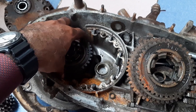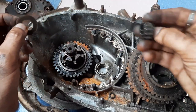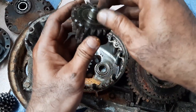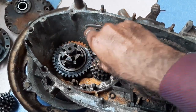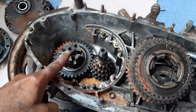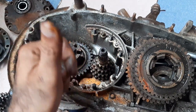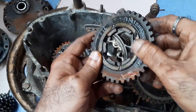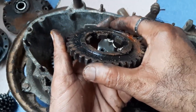I am now placing the fourth gear — it's in. After that, you place the needle bearing, and then replace the collar. The fourth gear's boss faces the sky; the remaining three gears face the earth. This is the third gear being placed — the boss faces downward. It is going in easily.